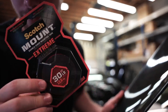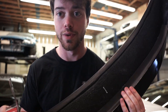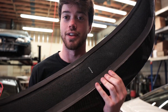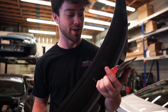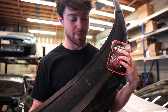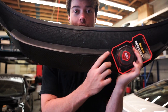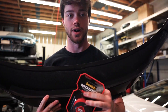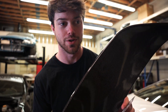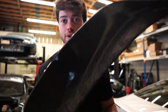They probably expected you to just apply a lot of double-sided 3M tape and have it stick and be fine, but I don't really want to only do that. The thought of just taping something to my car and having it stay on at highway speed kind of freaks me out. So we're going to attach it with the double-sided tape — it does say it's rated for 30 pounds — but I don't fully trust it either way. I'll probably just do two drill points, which I feel is plenty to at least hold it, and use the tape to secure it to the trunk. The GR1 from Toyota is way more simple, but this one is more complicated.